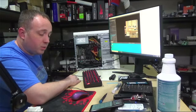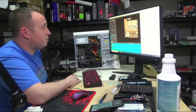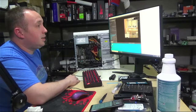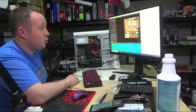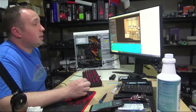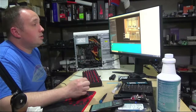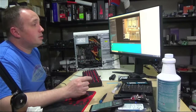If you direct it back to where it's downloaded, it rediscovers the files and fixes it though. Yeah, I'll have to take a look at that. I paused all the downloads right now. I have to do that separately. Well, let's just see if at least we got an improvement on our core temps by changing that super dead, dry, crusty thermal paste. And it looks like we're gonna top out. I don't want to speak too soon, but it started to stabilize at about 69 degrees Celsius on core 1.